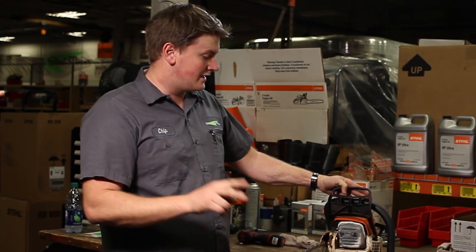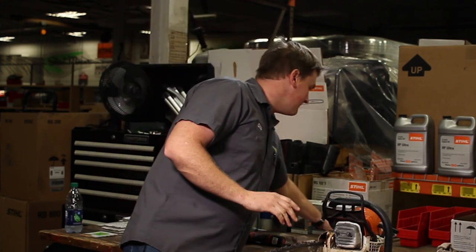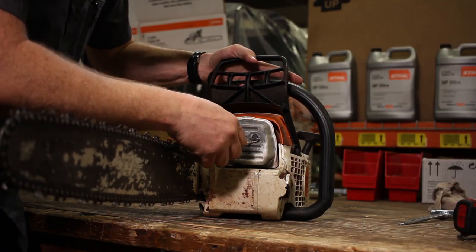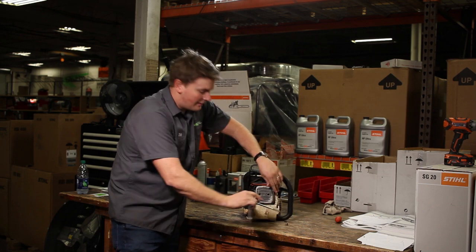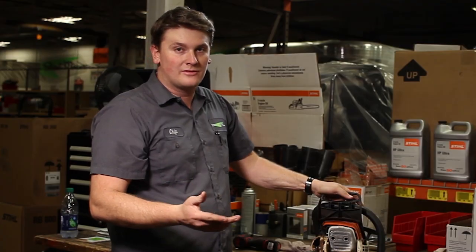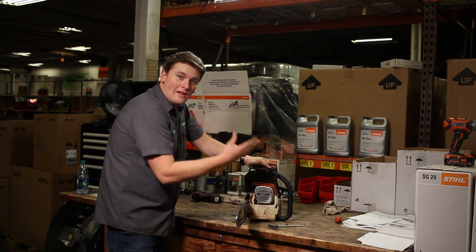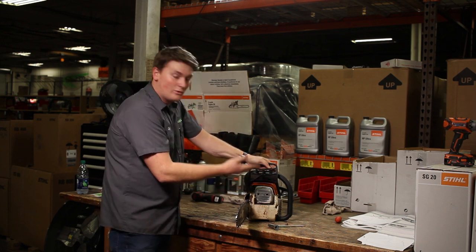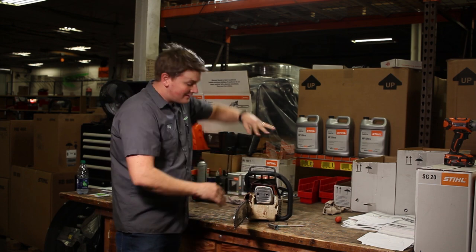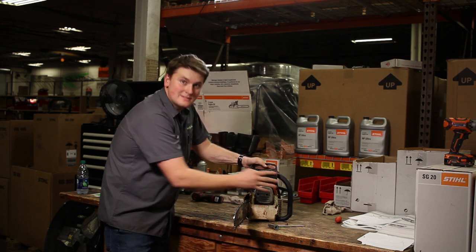Here's the number two skill — this will save you so much money and estimate fees, everybody's time. You get a flat head, you pry off your muffler covers. Pretty easy to do. I'm going to pull my muffler off. We say we look up its skirt. You look up through the muffler hole at the actual piston cylinder and you see if it's scratched or damaged. If it has vertical striations, the saw's totaled. If it has horizontal milling marks, then the saw's fine.